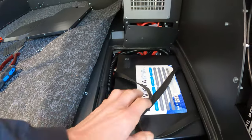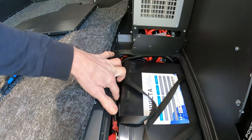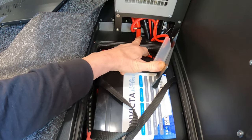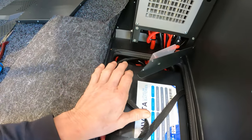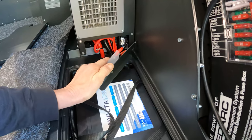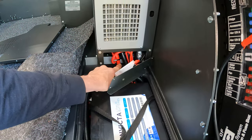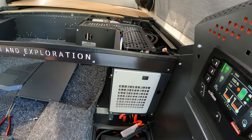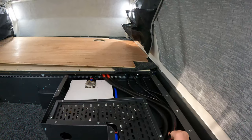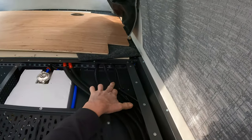You can see it's quite congested — the battery box in the T-Van is very small, there's one on each side. We've got a 50 square millimeter cable running through with corrugated protection. Positive and negative cables come up from each battery; the negative cables go to the shunt so the Redarc system can measure current flow to the inverter. Our positives go to a 250 amp mega fuse, which is the Redarc recommendation for this inverter, and then we go to our parallel 50 square millimeter actives and two parallel 50 square millimeter negatives.